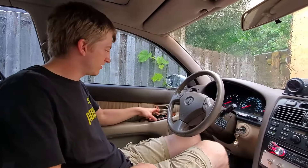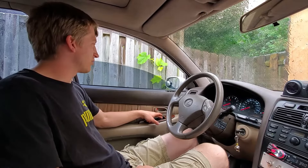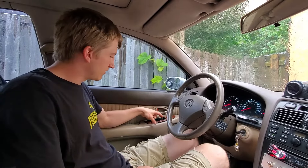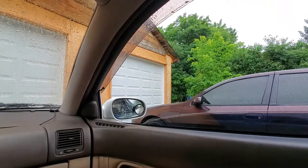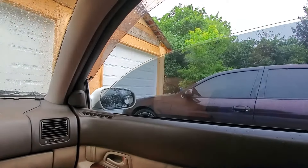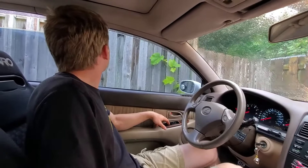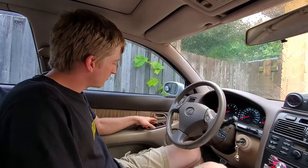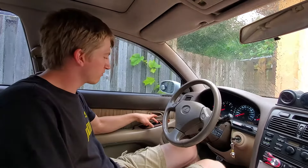So I'll show you guys what happens in my Lexus. My key is in the on mode. This is the driver window switch — down it works pretty well, up is definitely slower. For the passenger, front right, I'm allowed to put it down, but when I pull up on it, nothing happens. The window does work because if you use the passenger window switch, it goes up slowly but it does go up. So the biggest problem is that the passenger window button does not pull up the window at all from the master switch.